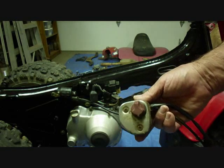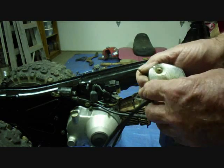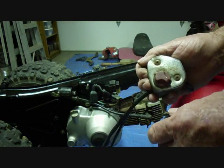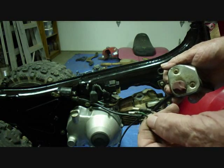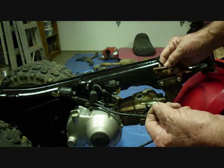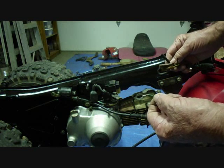This is a switch that was used up through 1981. In '82 they went to a different type of switch, but it's the same idea. The middle position is run and the left or right is off — kind of like a panic situation; you just turn it some way and it'll turn off. Out of the end of the wire there's a black and a green. The green is ground, so you hook the black to the black and the green to the green. Then you turn the switch on and make the connection — it'll ground them out and that'll stop your engine.